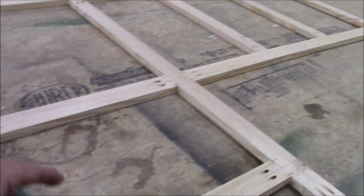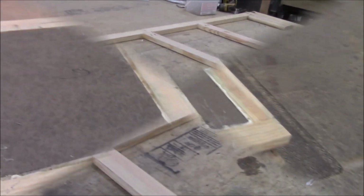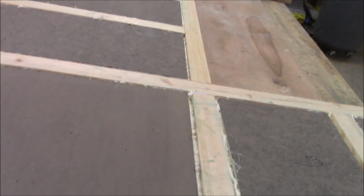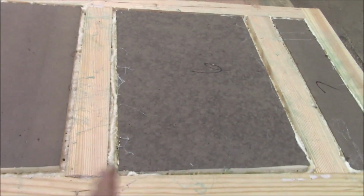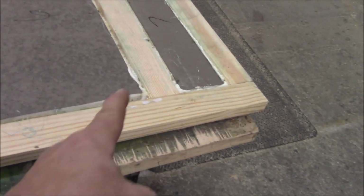But when we put the foam in there, we're gonna glue it all. Everything's all gonna be glued together. So you'll see. All right, so now we've got all this foam fitted in there, and that's an adhesive we got in there. So if you look at the first clip, you notice I put 2 screws in every one of those. So this is nice and strong now.